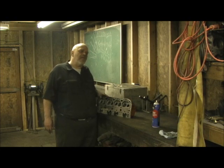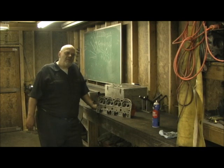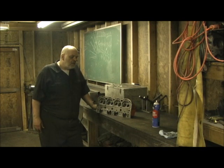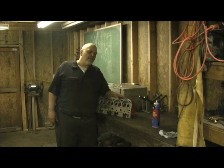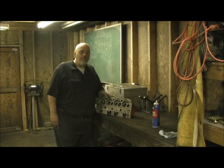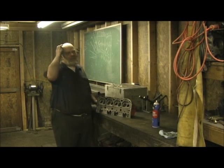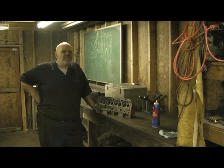That's why with the older heads, my factor of safety — I have to add additional meat when I'm in there with my sonic checker so that I don't bust through. On this head here, which is a stage four for Marty and Christy, what I'm doing is I'm going to go inside the head, use my plate system, and put a coating on this head.